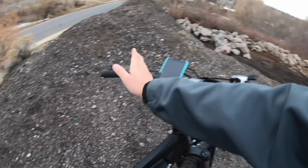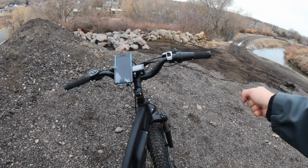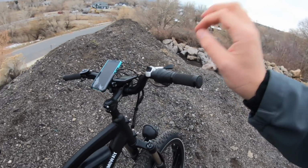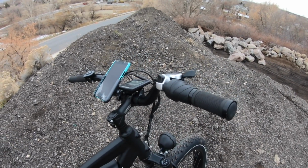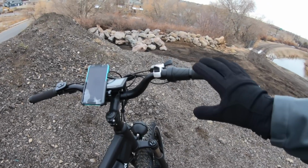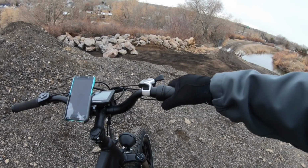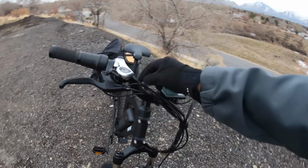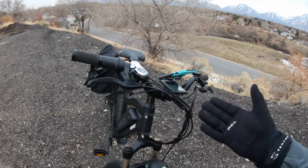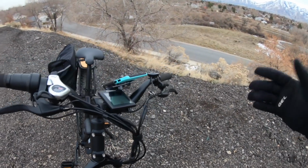They're 650 millimeters wide. So it's not quite like riding a school bus where, you know, it dips in all the way, but it's just a little bit of a cruiser accent that kind of lends to that ease of riding. So that's the handlebar set right here. It's pretty comfy, I must say, to be able to grip onto here. These, of course, are the levers for the mechanical disc brakes. They do have a motor inhibitor, which is a good safety feature to stop the motor anytime that the brakes are pulled, so you're never fighting against it.